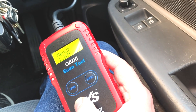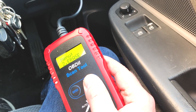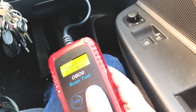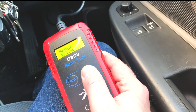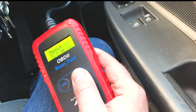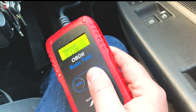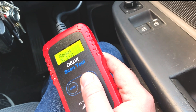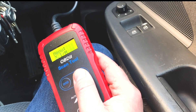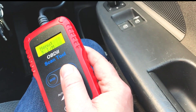Once it's gone through, you get this display here which goes onto option one, which is diagnostic trouble codes. You can scroll through the menu — it's very simple to be honest. You go through the options, and then option three I believe is information management or something like that. It's an IM readiness function used to check the operations of the emission system on OBD2 compliant vehicles — I'm just reading that from the instruction manual. It will check for and scan things like misfires, fuel system monitors, and comprehensive components, or check to see if the sensors are available, working, or ready.